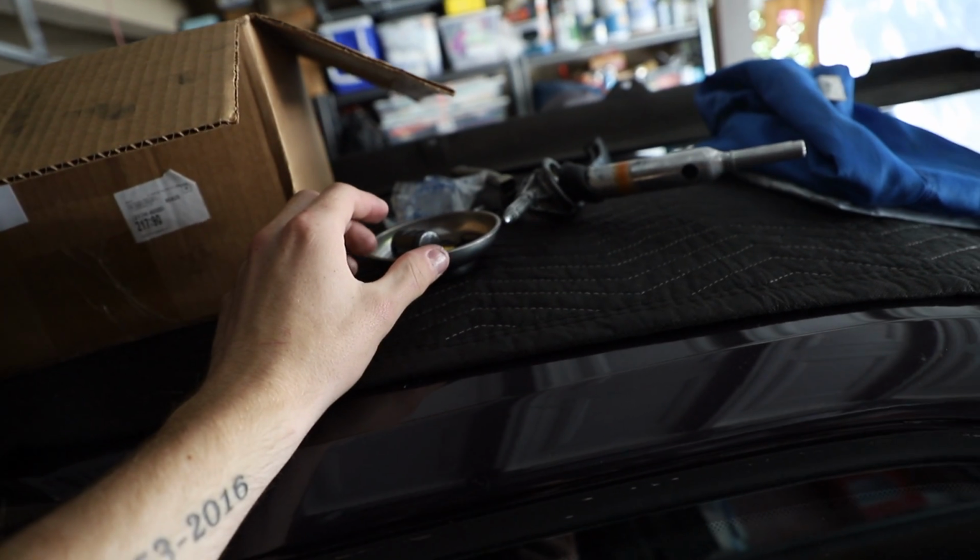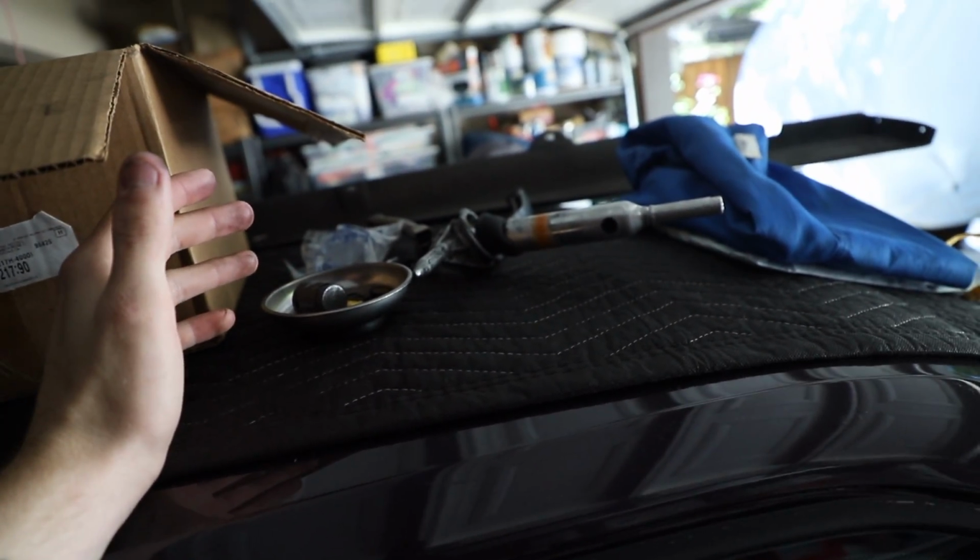So the issue with that is, let me explain. That's why I went under the car. I went to replace the selector joint on the transmission with the new one from BMW. This is an OEM part. Unfortunately, the pins from Garagistic for their DSSR did not fit through the new selector joint. So now I've got a selector joint that I just spent 3 hours replacing, because I didn't lower the crossmember or anything. I did everything in the car, by hand, and it was a pain in the ass. I'm not joking, I was under the car for about 3 hours.